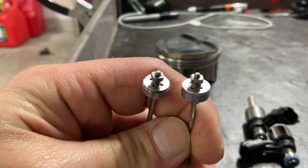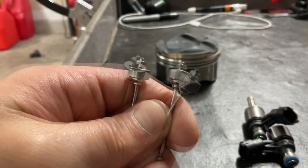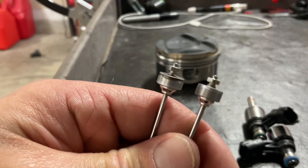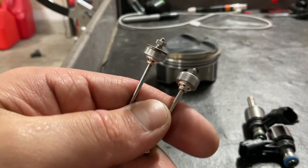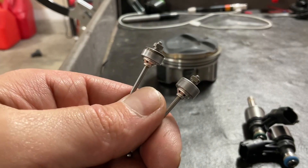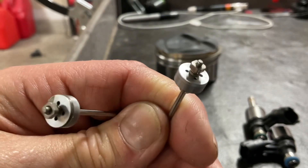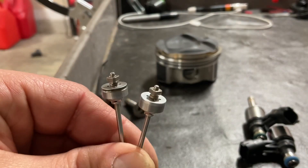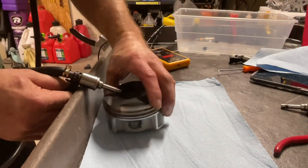The Honda injector is extremely susceptible to fuel pulsations and differences in fuel pressure — this is not an issue with the injectors that I sell. You'll also notice the materials are different, so the amount of force that can be generated on the piston in the center is clearly different, and the ridge there also has an effect on the flow. The actual holes in both of these piston designs flow way more than enough — well over four times what these injectors put out.